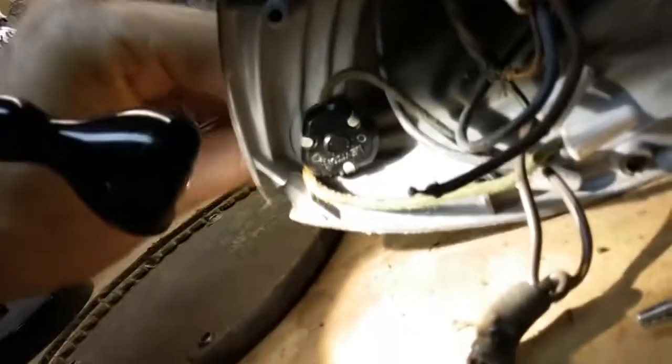That's what's happening inside this Leviton switch. The wire came right out and broke off. I might be able to fix the switch — I can try to open it up, take it apart, and see if I can solder that back on. But it might be better just to get a new switch; it's a rotary three-way switch. If I can fix it I probably will, because the switches back then are much nicer than the switches today.